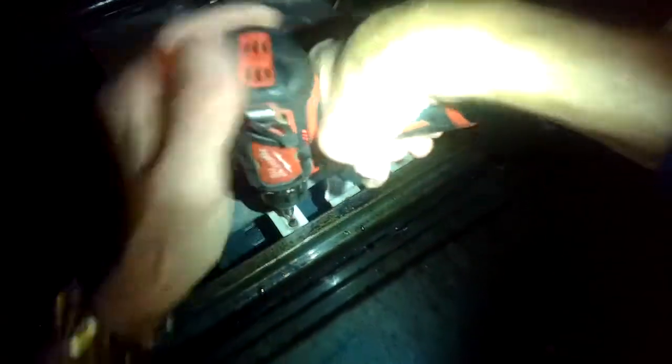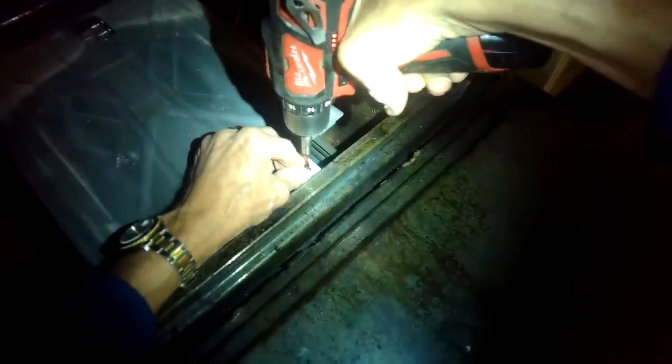Let it cool and then we'll put it back together. Here's the heat deflector — I'll put the front tabs in first, coming in at an angle, set the back ones in position and push those tabs into the firewall back panel, then put the two Phillips head screws in to hold it. Now adding the lower panel — come in at a diagonal, get the front lip to fit underneath, put the back part down, then push those two long Phillips head screws back in. You don't have to have those really tight; they're just there to keep that panel down.